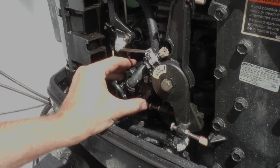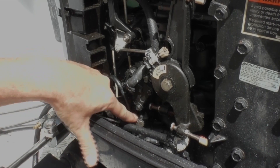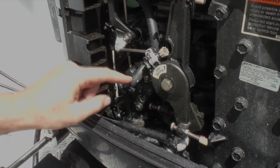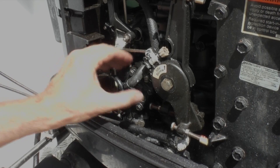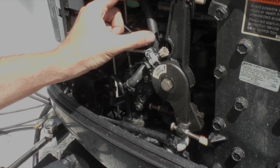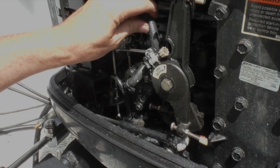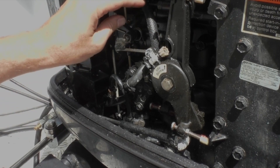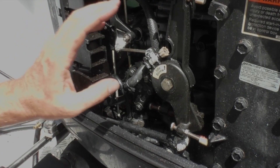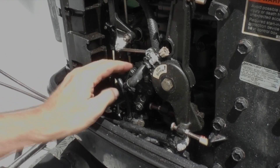This is the fuel pump here on the side of this Mercury. You've got the fuel line coming in, an oil line coming from the oil pump, a hose from the crankcase providing vacuum pulses to the diaphragm to operate the pump, and then the outlet hose. That outlet hose used to have a fuel filter inline, but I moved it to this glass filter which is now before the fuel pump.